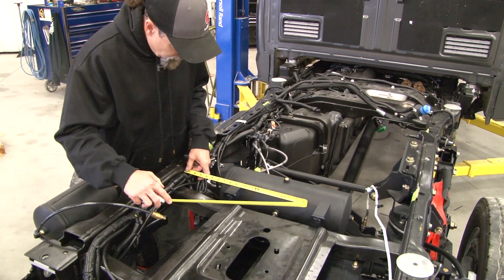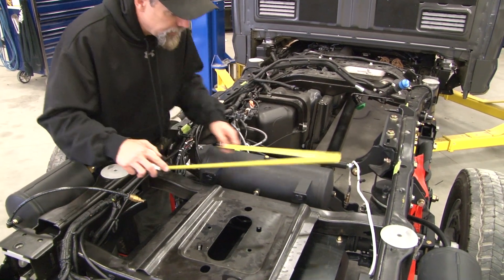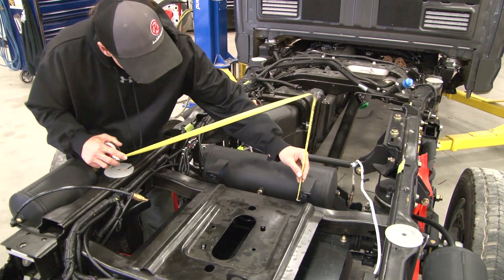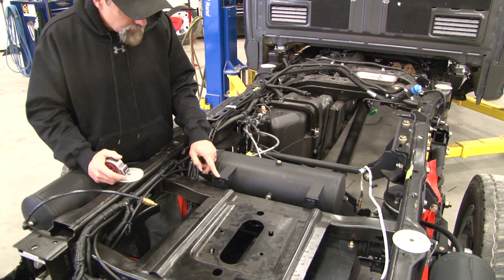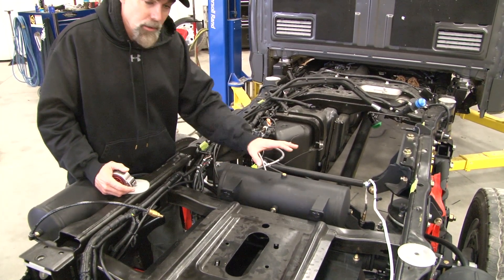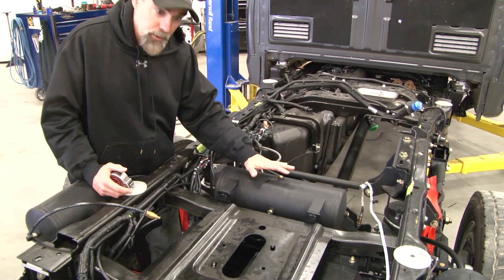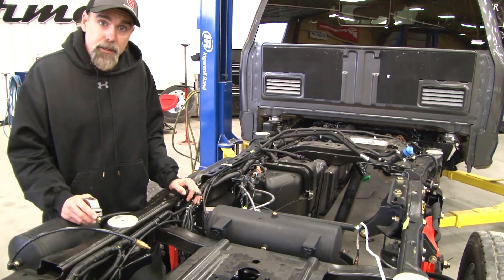So it's pretty easy — we're coming over eight inches, and it's about 21 and an eighth to here. On this little tab, we're coming up an inch and five eighths. That's a good measurement; it's not going to hit on the bottom of the box. If you get too much closer it will hit on the box, and we don't want to go too much lower where it's going to hit on the air dryer on the front side of the box. That's where you're going to mount the front air tank.